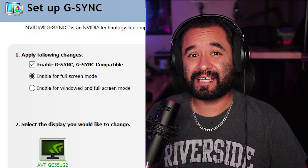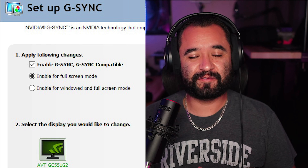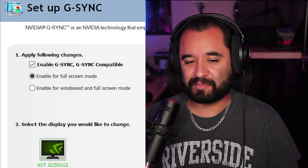Editing Chris here — I just remembered I forgot to mention something. When I had this hooked up from my laptop to the second PC, I noticed that in the NVIDIA control panel, G-Sync was available to be enabled on this thing. From what I understand, G-Sync is unofficial support right now, although because this supports VRR variable refresh rate, it makes sense that G-Sync would work. So that's really nice for a capture card to be able to support G-Sync that way.